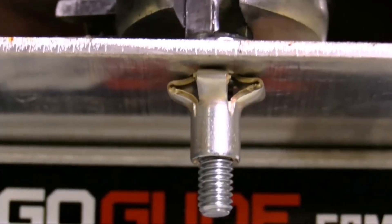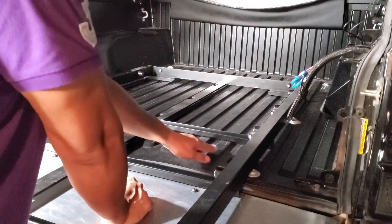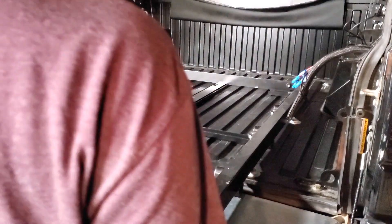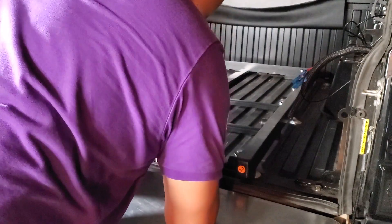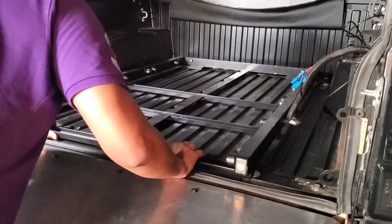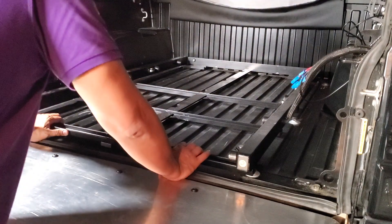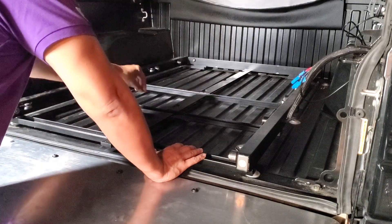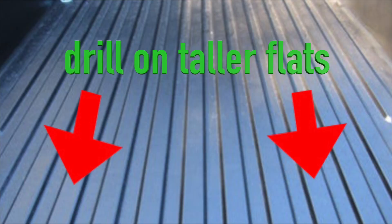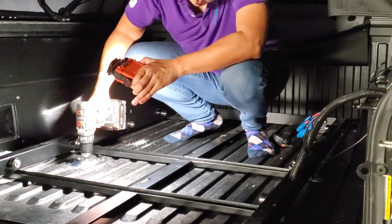What I'm doing here is trying to line up the frame so it is perfectly square to the bed. You can leave a little bit of gap in the front — about an inch — and on the sides you just want to make sure it's centered. You also have to pay attention to the bed ridges up and down, so you decide where you want to bolt it. I lined up the bolt holes to the top ridges so it would lay flat. Otherwise I'd have to use washers as a spacer for the lower ridges. I used a unibit versus a drill bit to get the holes properly done.